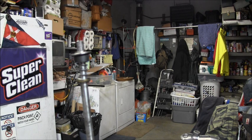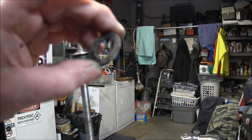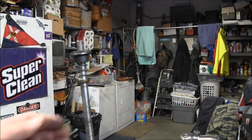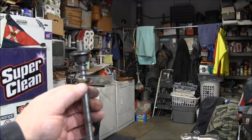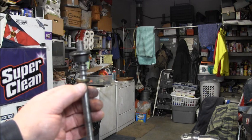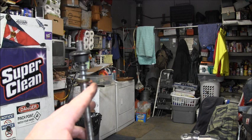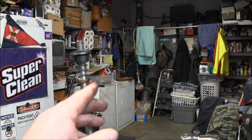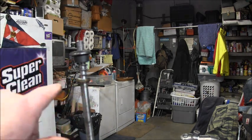And then you've got your, it's carbon felt cork, I don't know what it is, washer. And I'm going to make a new one of those. It goes there. That's the entire setup. Now, when you look up into that lower unit, all you're going to see is the bottom of this brass lower cup. That's what you'll see when you look up in there. But you will see two slots, depending on how much carbon buildup, grease, and all that. If you clean it out, that's what you'll see, the bottom of the brass and the two slots in the casting for the pin to go.